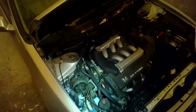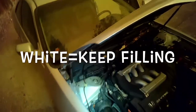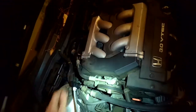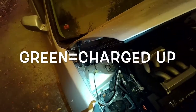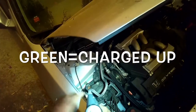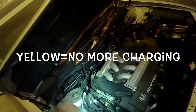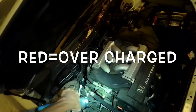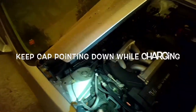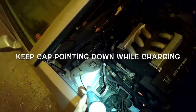I think this is going to help. I'm going to give it a little more. The compressor is off now. We're starting to get into the green during the compression cycle, but we need a little more refrigerant. I'm pulling the trigger — give it a little shake. It's non-compressed now. The clutch just kicked in. Almost in the green.